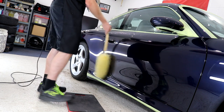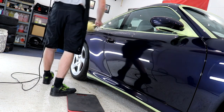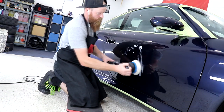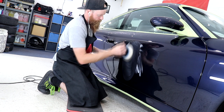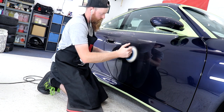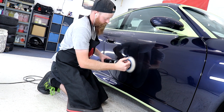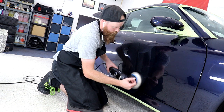Even if I'm unsure about whether or not the vehicle truly needs this slower finishing speed, particularly with darker coloured metallics, I do tend to just go ahead and complete this extra stage, as it only takes 5 extra minutes per panel, and it will ensure that the finish is going to be amazing when it's all IPA wiped down. I've learned the hard way, and so far by doing this process, it has never let me down.